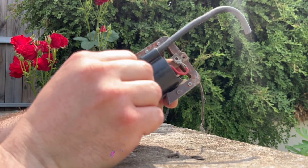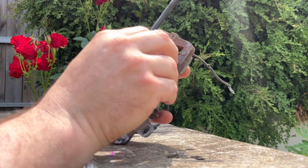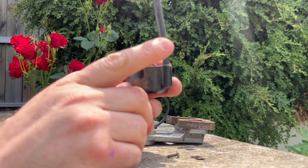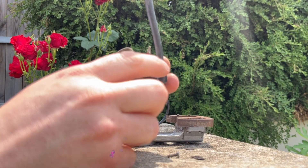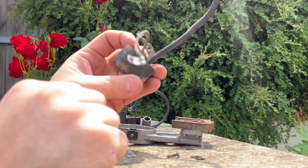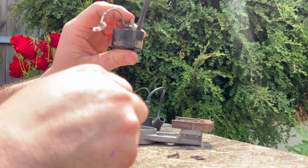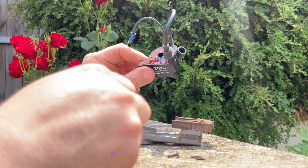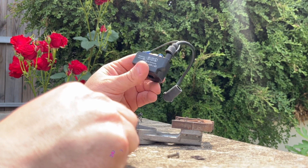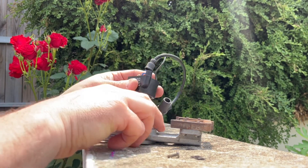Once you get it down to the end, pull that little retainer out and save that clip. Then slide your coil off. These aren't like the 580 ones — these are hardwired in. If they go bad, David Fillman has them on his website and you can replace them; his version is much cheaper. Or if you want to upgrade to this analog transistor ignition version, there are no more points.